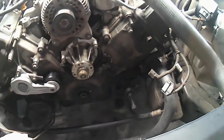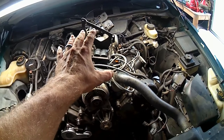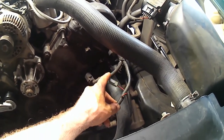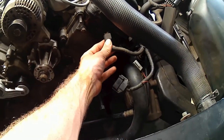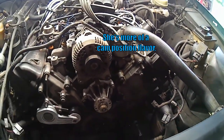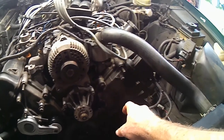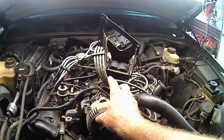And also, we've come up here, and you'll see there's a lot more clearance on the front end, and there's our ignition coils. I came over, unplugged the coil, and the other little thing that I forgot what it's called, from both sides, and on this side there's this extra sensor here. Maybe it's a knock sensor, I don't know. Got those taken loose. There's a couple 13 millimeter bolts, three of them over here, a bolt and two nuts. On this side it's two bolts. And then I just set them to the top for now.